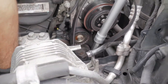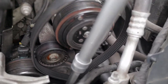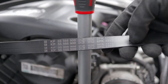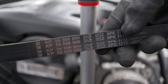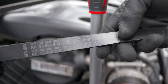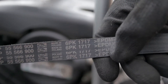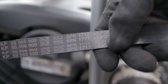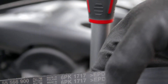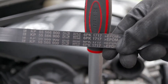There's a bigger pulley on the back side. I'm just going to remove the older belt and try to position the new belt in. Just to show you the part number of the belt — it's 55566900 from GM. This is actually manufactured by Gates as well, so that's a good thing that I'm using Gates. And in here it says 6PK1717 — I believe that's the Gates number. It's 6PK1718 on my new one, but fingers crossed we'll see if it's the right one. My engine is A17DTS with 130 brake horsepower. Just try to make sure to find the right one for yourself.